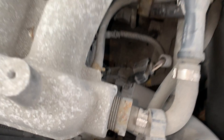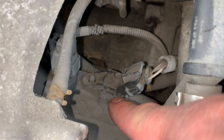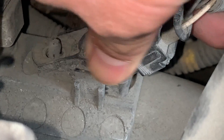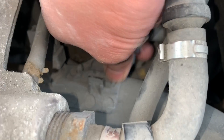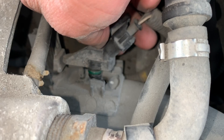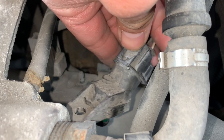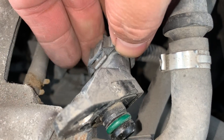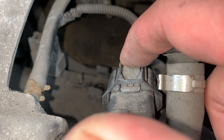On these Volvos, the manifold pressure sensor is right here. It's got a couple of tabs right where my finger is pointing that you'll need to spread out with a screwdriver or something, or rock side to side like I just did, and then unplug the sensor by pushing down right here. You might have to put a little screwdriver right where my index finger is to lift that up, because these buttons don't tend to work very well.